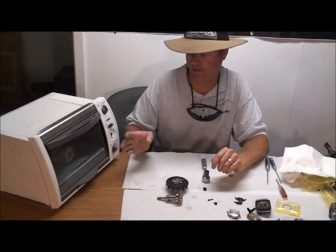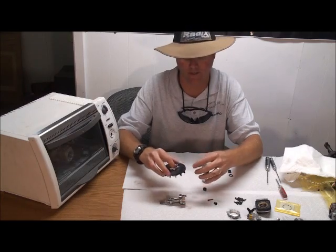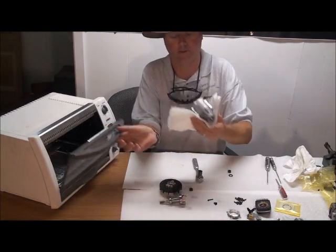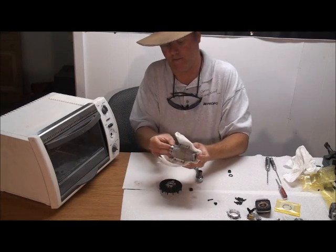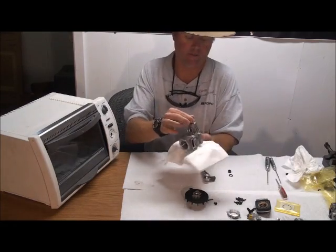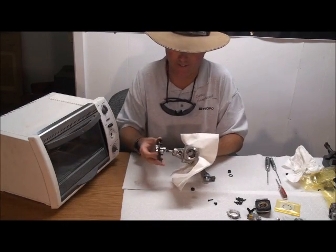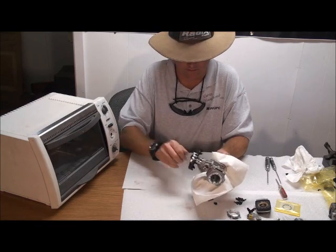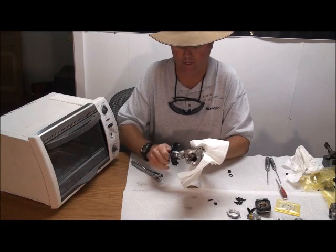Now to be ready for when the motor comes out of the oven, you want to have the crankshaft with the new bearings on it — front bearing reversed — the hub ready to tighten down, your wrench ready, and the nut for the motor. I'm going to pull the motor out of the oven — it's been sitting about 20 minutes at about 300 degrees, smoking pretty good. I just pop the front bearing in, hold it in place with one finger, then pop the back one in, hold it up, and I'm going to put the fan hub on. This part's better if you have an oven mitt so you can hold things in place. Put the fan hub on, then tighten the nut down on the motor — this is going to pull the bearings up tight in the case and make them seat properly.